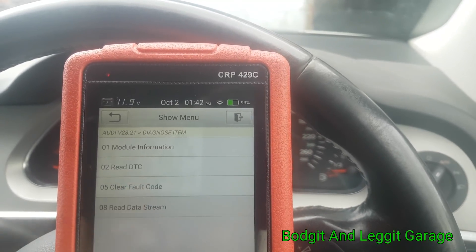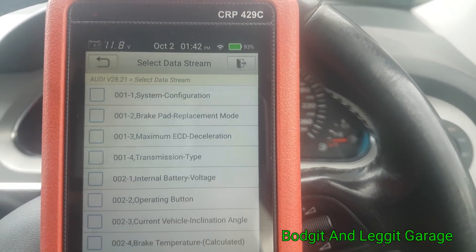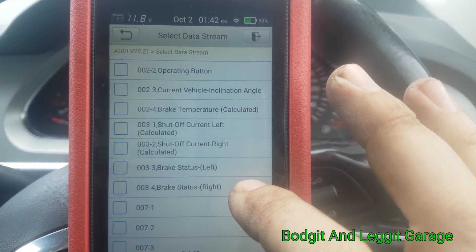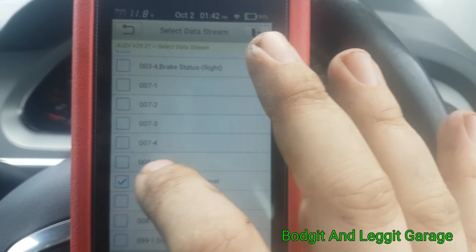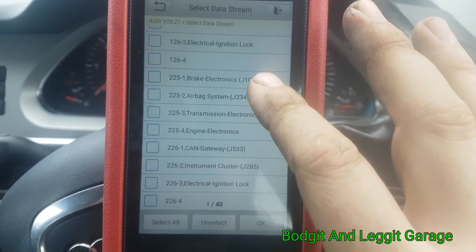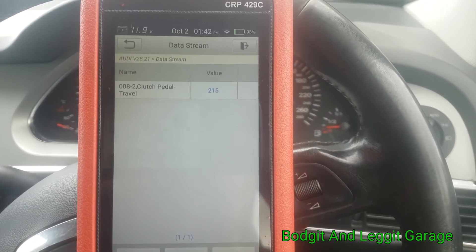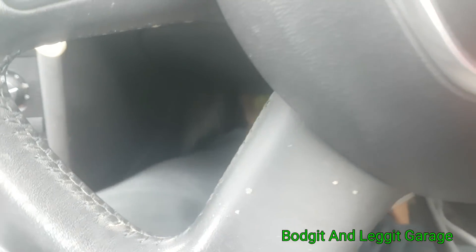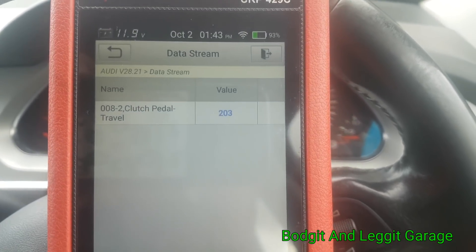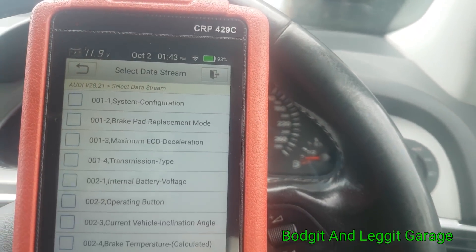We can go into our data stream. You can go by channel or go by list, depending on what you're used to. By channel, as you can see, we've got 002, 0023 — these are all our channels, depending on what software you're used to. We can go to — do we have a brake switch problem? Let's click on that — and there we go, our clutch pedal travel. As we press the clutch down, we've got our live data. We can see that the clutch pedal is now working. That could have just been an old fault because there's no fault code in it now. With something like that, look how quick and easy live data can really get you in the right direction.